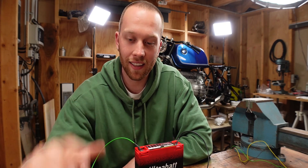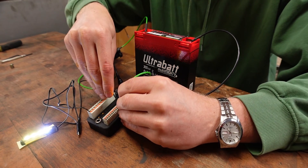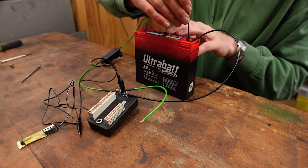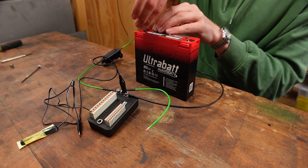The lights flash all around and we have constant power to the license plate light — that is the first test done. Let's move on and add the indicator and the little switch. To be safe, let's take this wire back out and disconnect the battery cables — the ground wire first and then the positive wire.